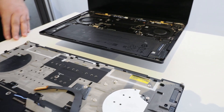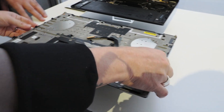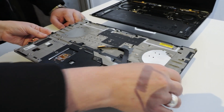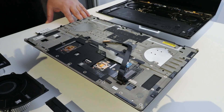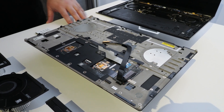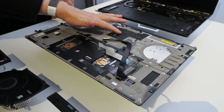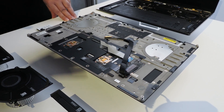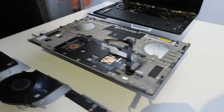What's happening on the bottom edge here? So this is actually the keyboard side — I've turned it over so you can see the inside of both of them. What we want to highlight here is: Jeff talked on stage about the Gore aerogel and the thermal insulators we use. We use graphite sheets — an example is here — and the Gore actually lives right underneath there. That's helping dissipate heat faster, directing it where we want it to go out the back, and blocking it from coming up through the keys.